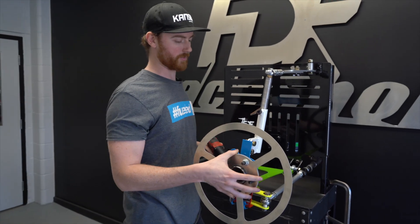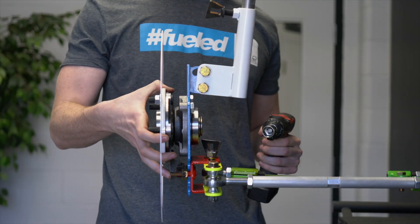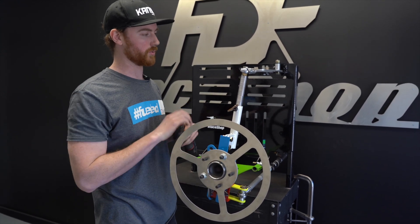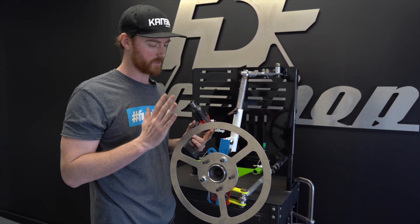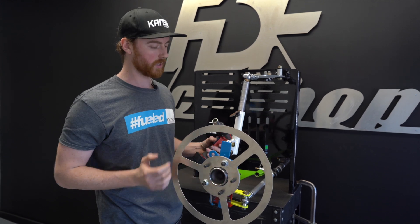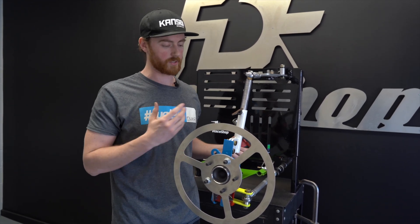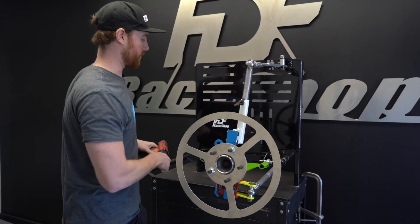The next point is to show you where you can adjust your camber from on a McPherson strut. A lot of times you can get some camber adjustment out of the wheel itself — this is what I would call a static camber adjustment. It doesn't have anything to do with your KPI setup or your caster setup; it is specifically right at the wheel. This is typically a very minor adjustment with a short slot in the coilover designed to work with the settings of the car it's on.